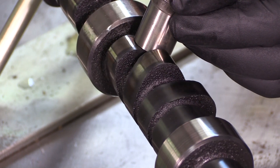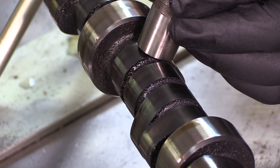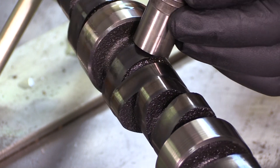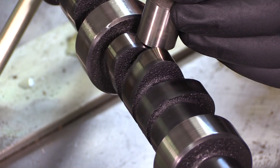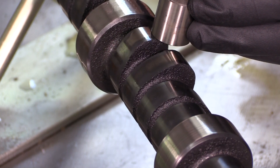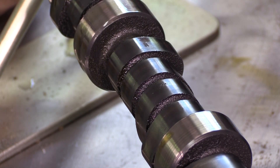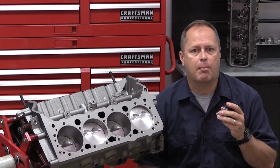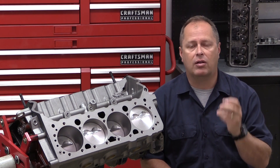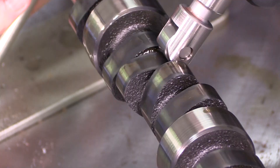As you can see from this mock-up, you want the flat tappet lifter to ride straight up and down as the cam lobe moves underneath it. If there's too much clearance in the lifter bore, it can allow the lifter to rock back and forth, and the worst thing that can happen is if the lifter catches an edge on the camshaft lobe as it rotates up. That edge will wipe away all the oil between the lobe and the lifter, and you'll start getting galling on the lifter face — and soon after that, micro welding between the surfaces of the lifter and the cam lobe. Next thing you know, you've wiped out a lifter and a cam, and a lot of people blame this on oils or lifters when the problem all along is actually poor machining tolerances.